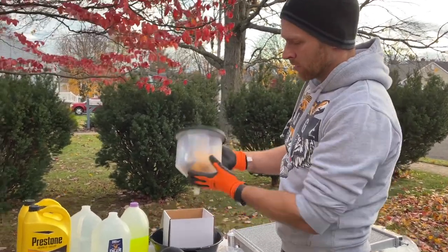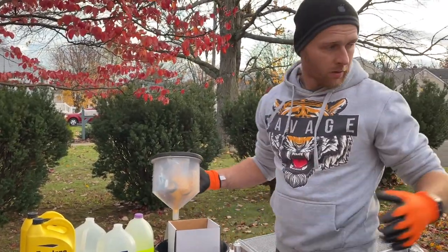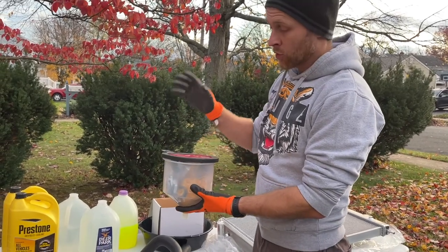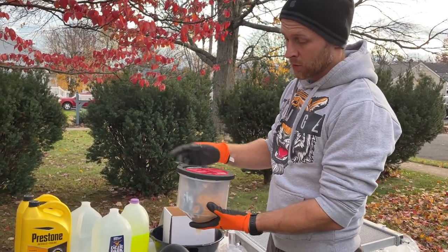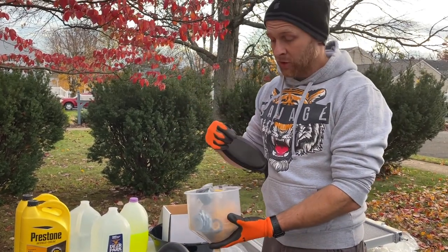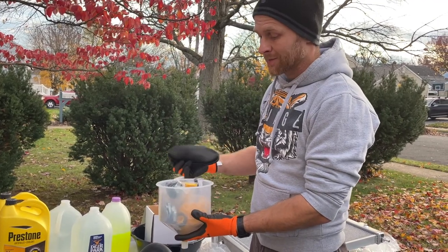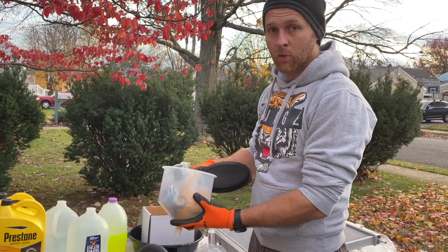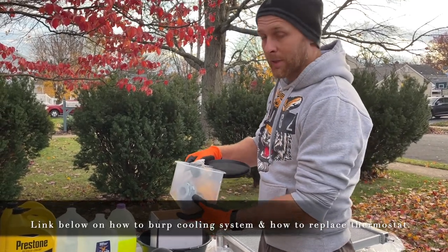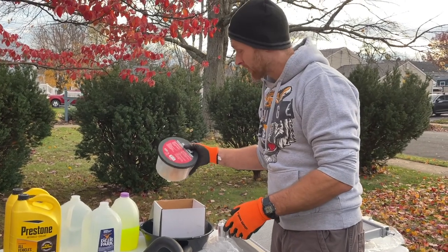I also picked up this no-spill coolant filling and tester kit. You're going to need this to top off your system and also do a burp of the cooling system to make sure there's no air in there. I'm going to do a follow-up video on that so check the link below. It's very important after you replace your coolant, drain your radiator, or put a new one in — you have to burp your system to make sure there's no air in the hoses. I picked this up on Amazon for $20 because AutoZone is about $50.